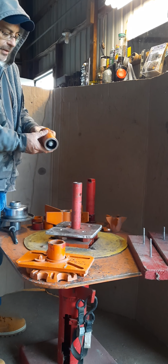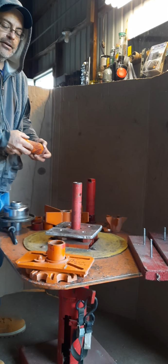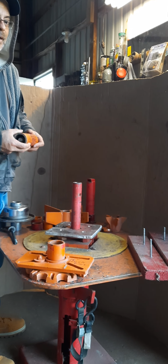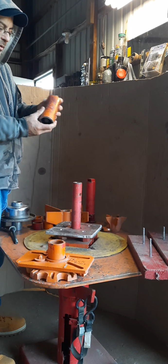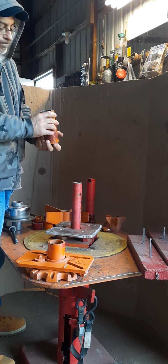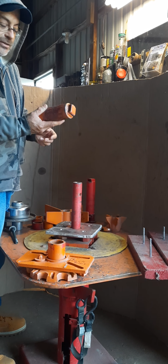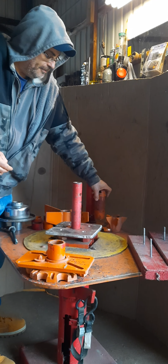And then I bought another one of these off of Northern Tool and Equipment. They actually had a better tire changer. It was heavier duty, but they don't make it anymore. But some of the parts were available. So I bought one of these and I cut it down and I added pieces of pipe inside of here to adapt it so it fit. And actually I didn't weld anything. It's all JB Weld I used.